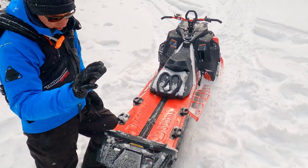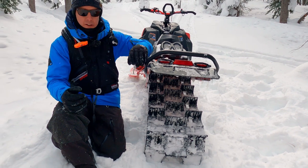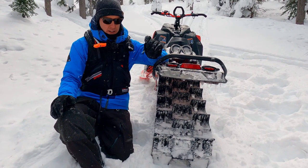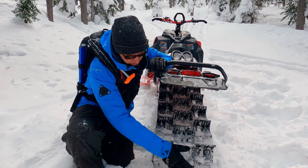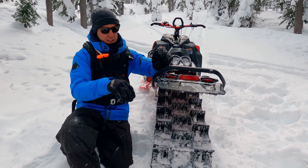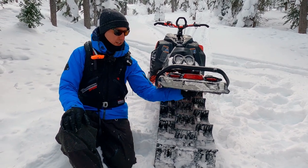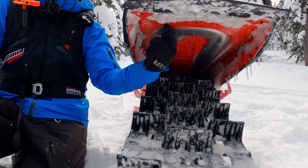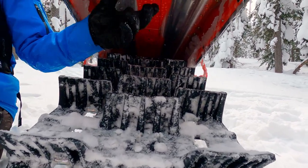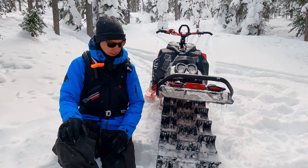Short tunnel, and we've got a new snow flap for 2023. Those of you familiar with the 2022 Boondocker DS know it had that unique snow flap — but it weighed around three pounds, could drag a little bit, and would affect wheelie performance. So that's gone. Now we've got a short tail flap — it does a great job of cooling and gets the job done. The cooler has also changed inside to more of a circular shape, the geometry is different, and the volume of coolant has changed. Overall the whole thing is lighter — about a pound lighter dry and three pounds lighter wet.